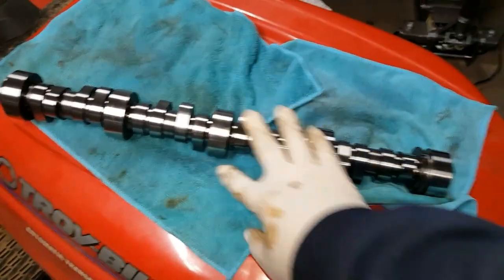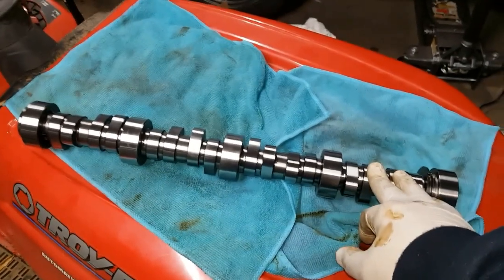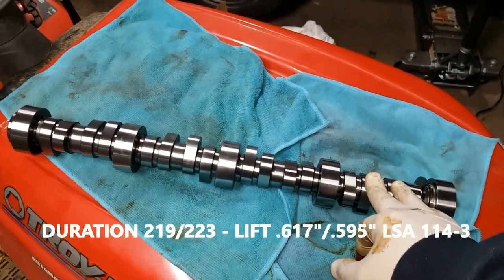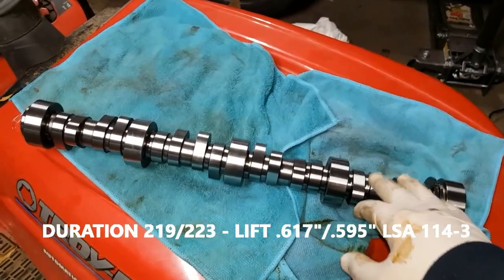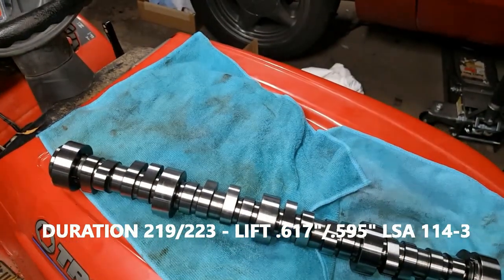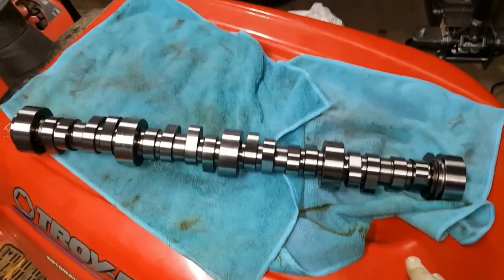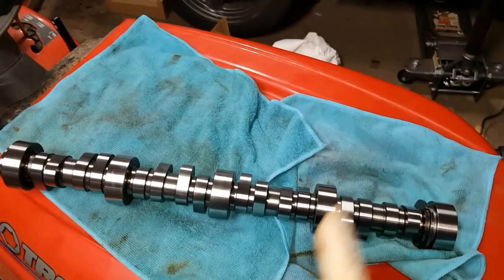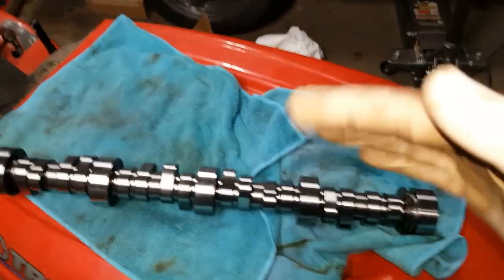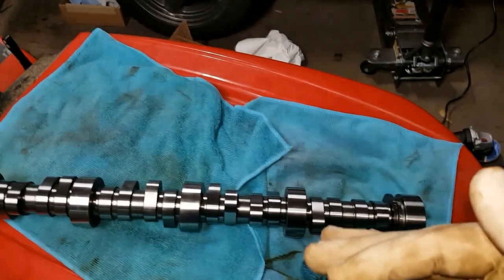Nothing crazy about it or anything. Instead of 595 lift, it's 617 lift, with roughly the same duration, and exhaust lift is actually a little smaller. I'll tell you guys what, I'll list the cam specs right here. Voila. And I'll also put them in the description for you. Although I already talked about them in another video, and I'll try to go back and link it right here, where I showed the different cam specs of the 3 different ones: the stock LQ4, the TIC Stage 2, and the sloppy Stage 2.